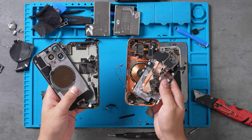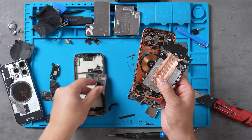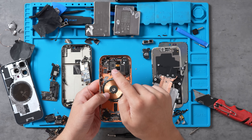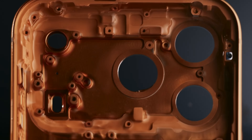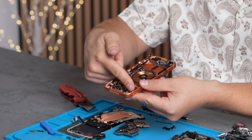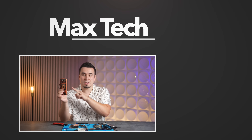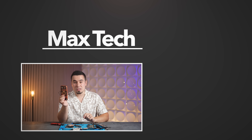So that is the 17 Pro teardown compared to the 16 Pro. What did we learn? Apple went all out on cooling — previously the chip basically had a bad heat spot on the side. The only way they fit in the larger camera sensor with the larger module was by milling out the camera plateau, which gave them a ton of precious space — genius engineering by Apple. If you enjoyed this, let us know in the comments below and subscribe for our ultimate comparison video.